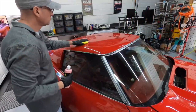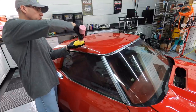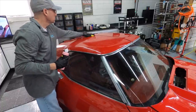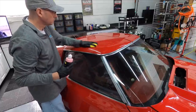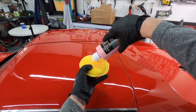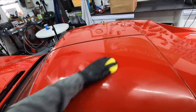You can use it by hand or apply it by machine. If you're going to apply it by machine, grab one of those black applicator foam pads. If you want to apply it by hand, just a microfiber applicator will do — a drop or two, work it into two panels at a time. I like to let it sit for a few minutes, not wipe it off directly after applying it, but I don't want to let it sit too long. So in this area, I'll apply it to one of the T-tops, hop to the other side, apply it there, come back over and wipe off what I applied. That's the perfect amount of time to let the acrylic and the rich blend start to bond to the surface.